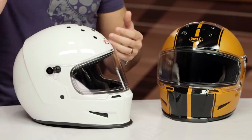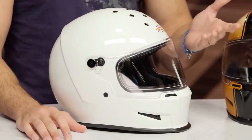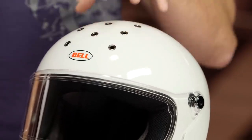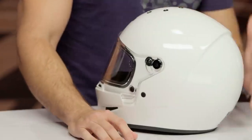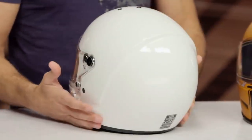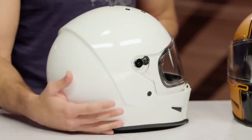Diving into some of the other nuances on the outside: there's no chin vent actuation, just slits on the side — from a functionality standpoint it could be beefed up, and there's no ability to open and close and shoot air up to the face shield. Moving up to the top, we have these really cool grommet vents — I haven't seen grommet vents in a while outside of some retro-inspired lids. But if you ride in the rain, think long and hard, because you're going to be washing your hair every time you get rained on. Working our way around to the back, the framework is fiberglass composite, super lightweight but very simple — no exhaust vents, no venturis, no passive ventilation. I'll give the ventilation a B: it's okay, but you can't close it.